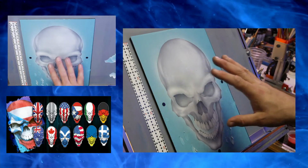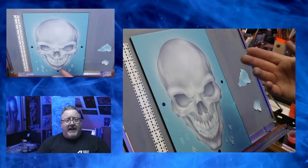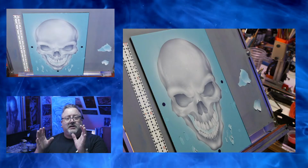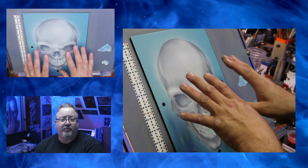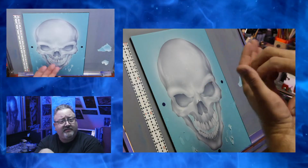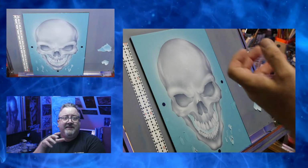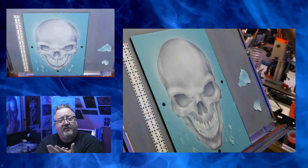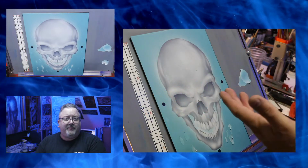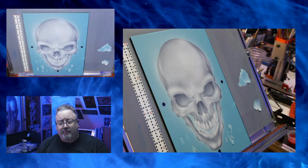The majority of the reasons why people get paint delamination at this stage is, remember when I was putting that first coat of paint down, I said, keep it a medium wet. You don't want to put the airbrush far back and mist and let the paint dry in the air before it hits the surface, because what you're going to have is what's called airborne loss of solvent. And when it hits the paint that's already down and sanded and prepped, it's too dry to bite in. You need a little chemical bonding there, or even mechanical bonding. You want it to settle into those sanding scratches. But if you just dust, you'll have that dust layer, then you paint, and you have a paint layer. And when you put masking on it, that wet paint is on top of a dry dust layer. So you want that nice medium wet contact, especially in those first couple stages.